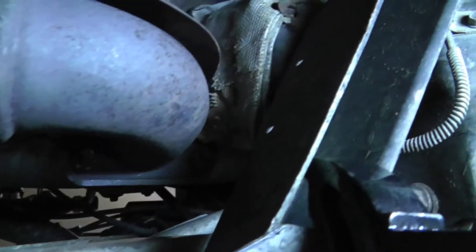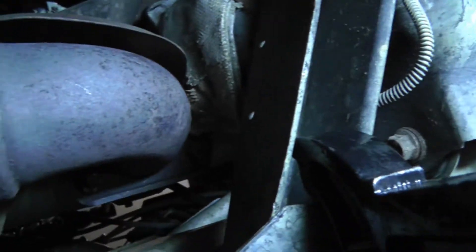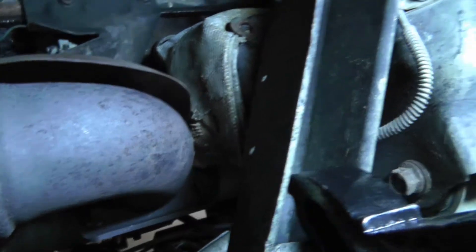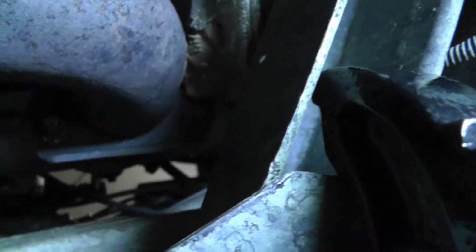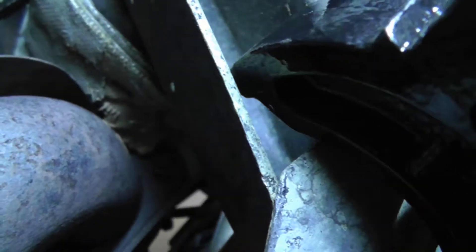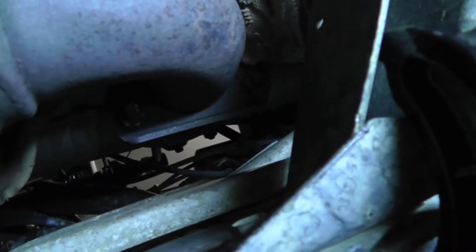The first thing I'm going to do is remove these bolts from the catalytic converter so I can drop this whole assembly down as one piece - drop all of the exhaust down. The exhaust is not a standard stock exhaust; the previous owner had something different up here. It's all one piece dropping down from the stock exhaust manifold. It's easy to get your socket on all three bolts - one, two, and three. I had to use an elbow on one of them, but it's easy to get the socket on. It's 14 millimeter.